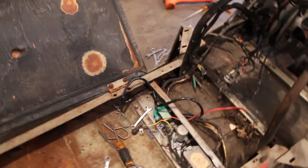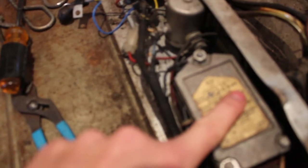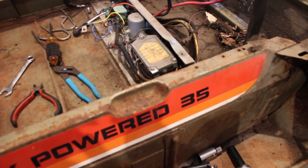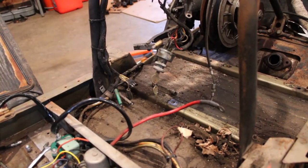I got super lucky. All I had to do was pop this guy in here — there are two wires coming off of it, one is a ground, the other comes back to the CDI box, or power pack as they call it, which is essentially an early CDI box. I had to hook up that one lead on the inside. This thing actually has reverse and electric start, so I popped a battery in it, bumped it over, and it had pretty solid spark.